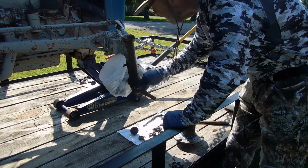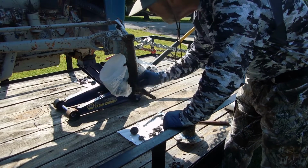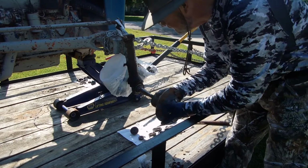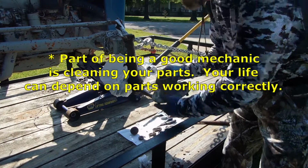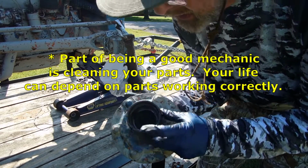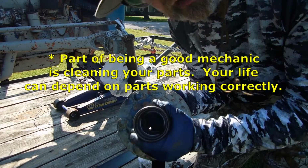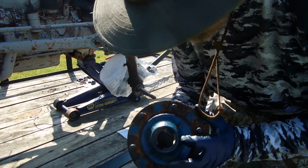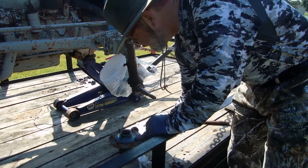Say, are you obsessed with cleaning? No, I'm not. However, you're talking about precision machinery here, and you're running these things on precision tolerances, and so it's important to get every one of those shoulders in there clean so that you can drive those races back in and they seat, and not seat against old material, but seat metal to metal. So that's why I took so much time to clean all these shoulders and all of this out. And I'll leave this sitting right here.